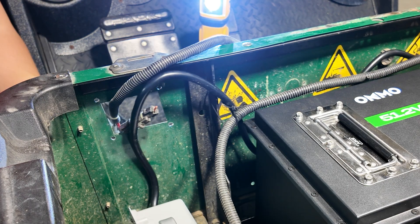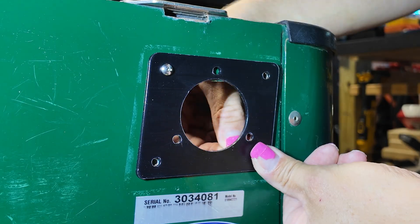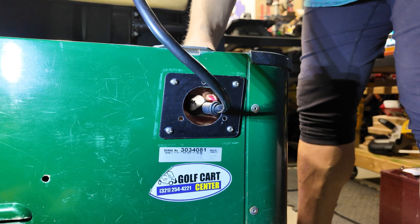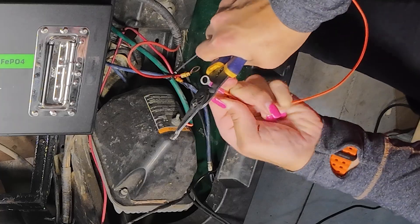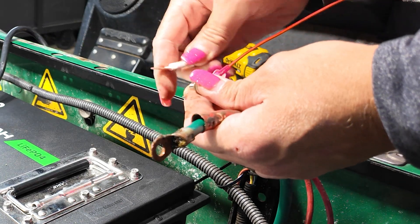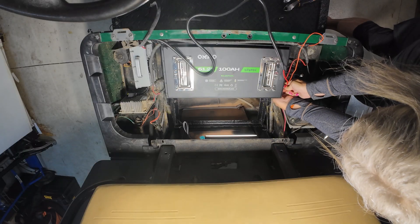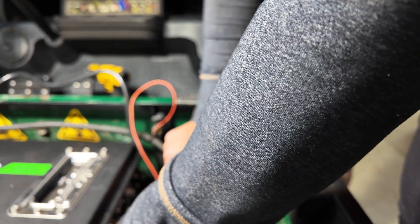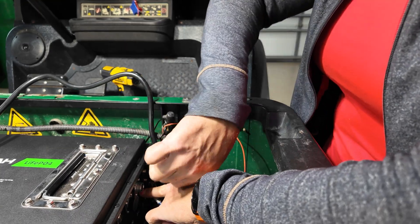After you've taken off the old terminal ring connectors from the old battery set, the only wire left that you'll have to cut is the reed switch wire — typically an orange wire. You want to cut it as close to the charge port as you can, then reroute it with an eyelet on it and hook it up to your 48-volt positive source from your new lithium battery. This wire is a protection so your cart won't move if the charger is plugged in. If you don't connect it to a positive source, your cart will not move forward.